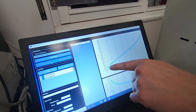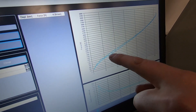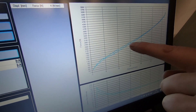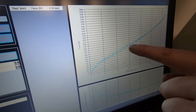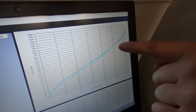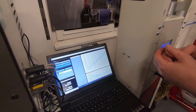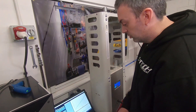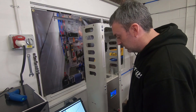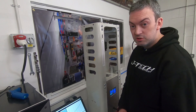There you can see — with the Meg Neg we've got a softer initial part of the stroke. You've got the balance point flat spot again, and then it's fairly linear through the middle of the travel, and then progresses up very similar to the Debonair towards the end. Again, that's with no spacers in the negative or in the positive chamber.